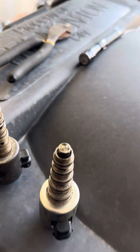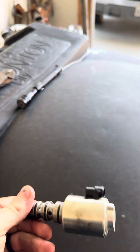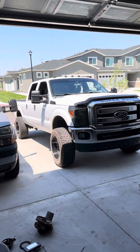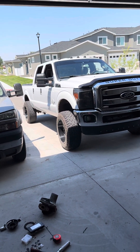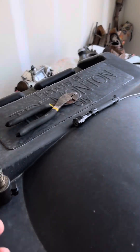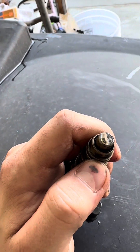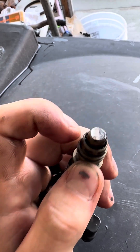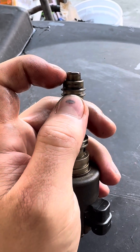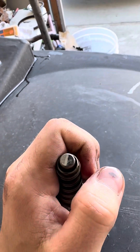I just wanted to give a little insight on vane control actuator solenoid for your 2011 to 2015 Power Stroke, and on the 6.0 — 6.0s have the same thing. A little thing to look for if your vanes aren't actuating: look at the tips of them. This one's got a little groove in it — a shiny groove — and just a little bit of a lip is enough to keep your vanes from actuating.